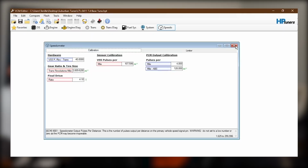198. So one more thing to keep in mind, whenever you install the 0411 in a truck like this, one of the things that you have an option to wire for is the park reverse neutral drive indicator. Now there's a switch down on the transmission, and in some applications that switch will go directly up to the PCM so it'll know which gear it's in. Now, it's actually optional if you have HP Tuner software to wire that up. I actually chose not to wire it up because that's four more circuits that I'd have to run. I'd need to take wires down from the transmission or from the back of the instrument cluster and run them through the wiring harness and up to the computer.